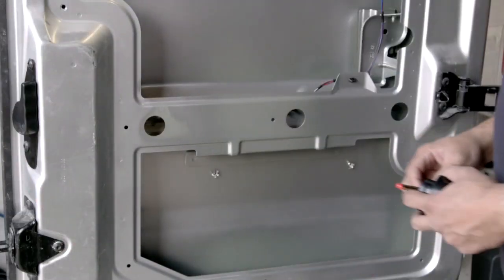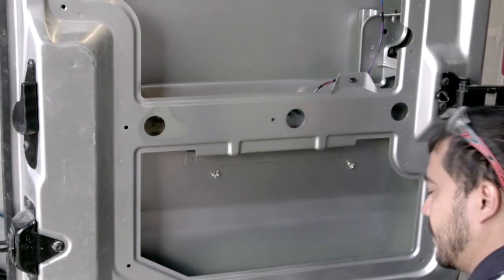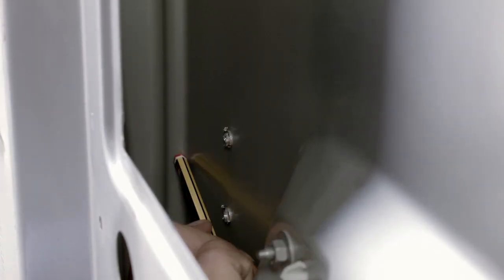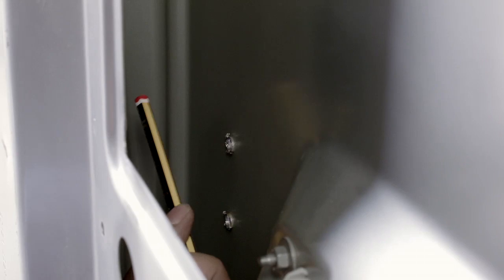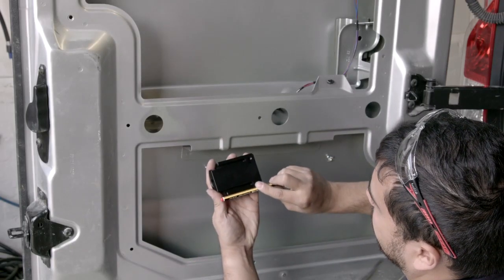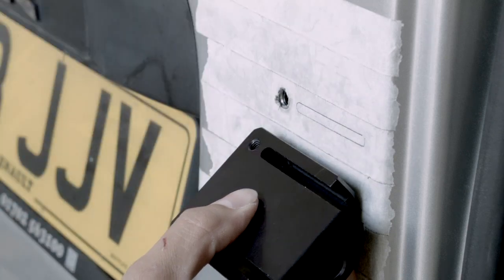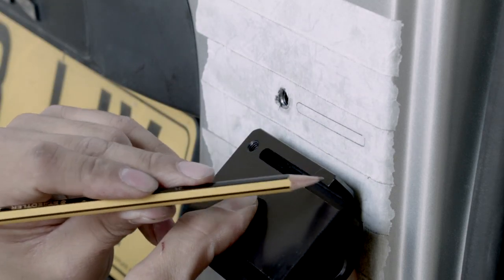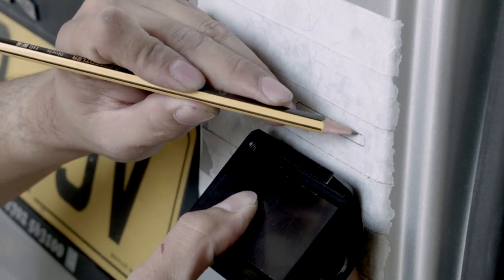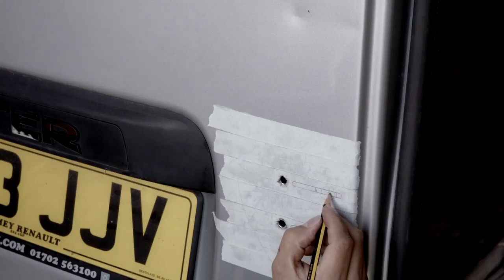Before drilling into the slots, we need to look at the inner side of the door to see what possibilities there are for these fixings. Using one of the drilled holes as a datum, we will slide the pencil along the inner door skin until an obstruction is found. On this van, we arrived at the door return metalwork. We can now transfer this measurement to the outer door side to identify the best positionings for the fixings. It's good practice to spread the fixings load as wide as possible, but not too close to the end of the slots.